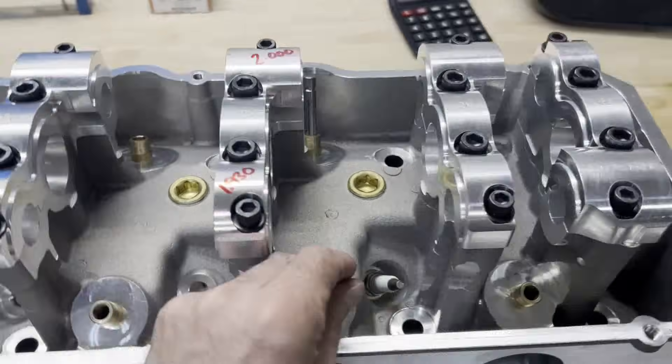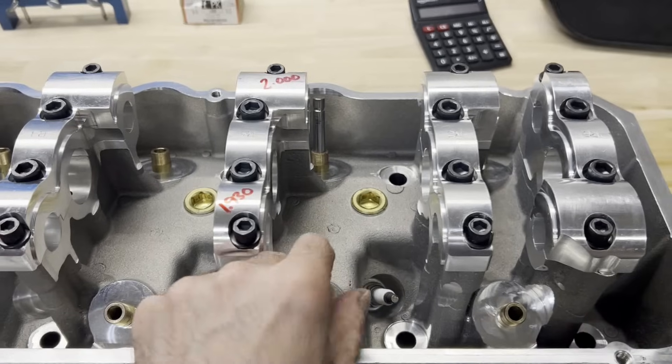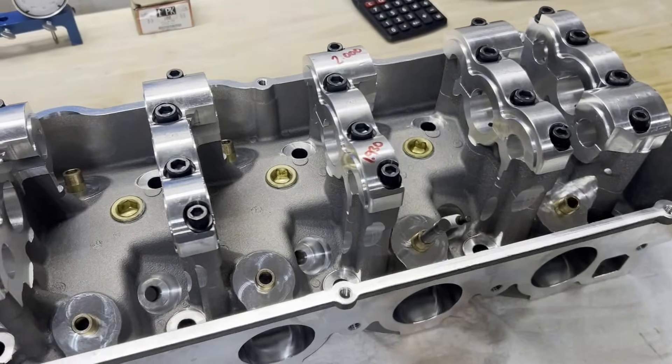That'll get me started for this project. I can get my pistons ordered with all the specs dialed in, including dome size, and I can start ordering my valve spring package. That's just the kind of step in the engine-builder direction — figuring out what you need and making everything match. Hope you guys are having a good week. I'll have more on this, hopefully next week when the parts come in. I'll show you some head assembly and we can put these to bed until the block is machined. This is a step in the right direction — talk to you soon!